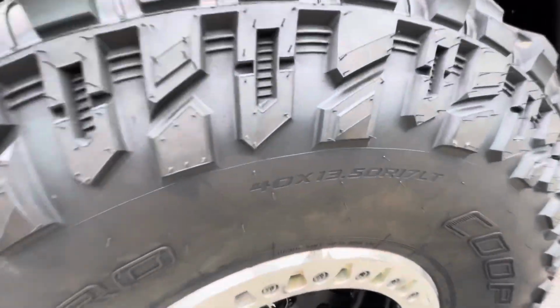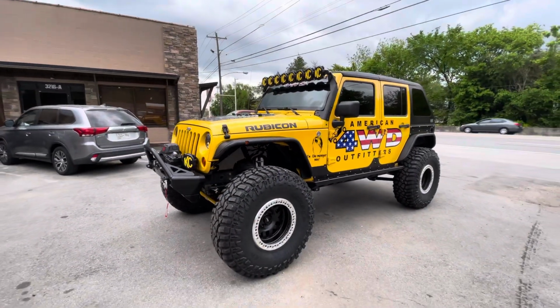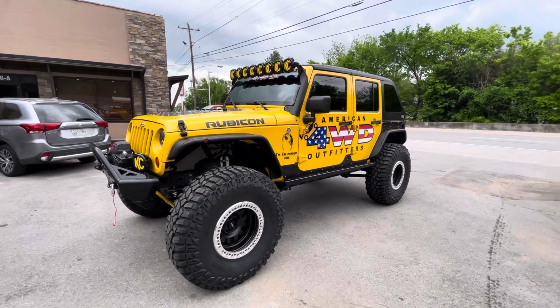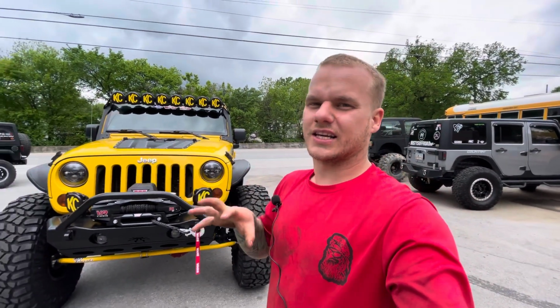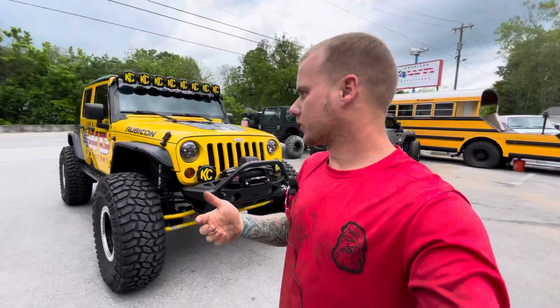The only reason I went to 40s is because it was one of those situations where we could get them extremely cheap, and we actually made money going to 40s. But at the same time, you want a big tire for rock crawling, because if you have a small tire, you're going to constantly hit the belly of the Jeep, and it's going to make every obstacle you go over a lot harder. If you have a really big Jeep with really big tires, it's easier to go over those obstacles and crawl and things like that. So it makes it really easy.